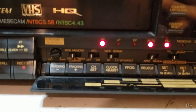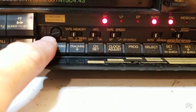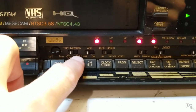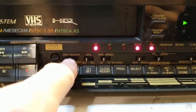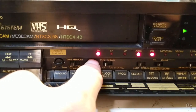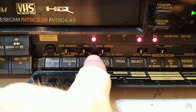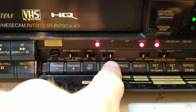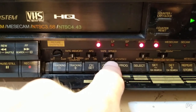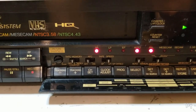Finding a Hi-Fi multi-system VCR in North America is pretty difficult. There's a sharpness control, tape memory counter that resets at zero, and it actually supports index so you can record indexes on the tape and fast-forward or rewind to them — automatic find control for the tuner. Regarding tape speed: being a JVC it only supports two speeds, but it uses LP for everything except NTSC. All the 625-line formats use LP, which was pretty typical; EP for PAL formats exists but is very uncommon.